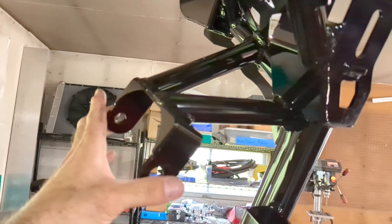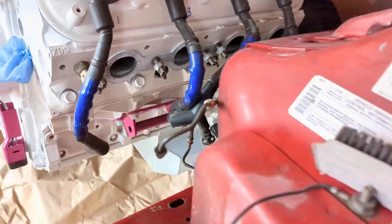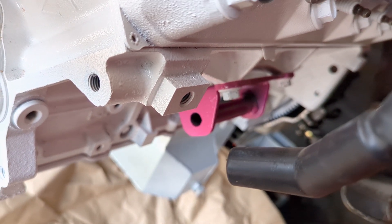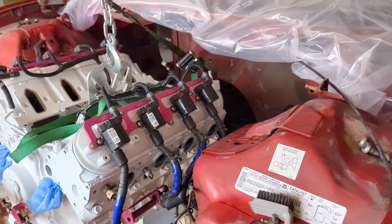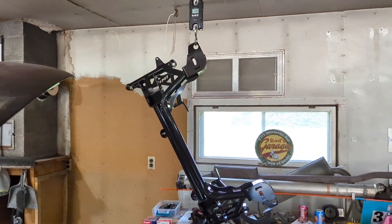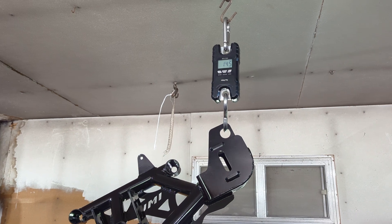Since I wanted to go with solid motor mounts, while that's an increase here on the K-member, it's overall going to be a decrease in weight with the solid motor mounts on the engine. Those guys right there will just lock into place on those pedestals on the K-member, and then there's no rubber, no polyurethane, none of that stuff. So overall we get a weight savings there. Just wanted to give you guys a quick update and show that to you as we keep progressing. Thanks for watching — stay tuned.